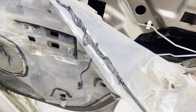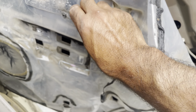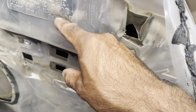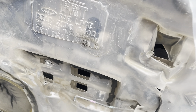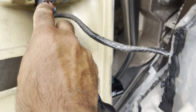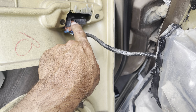Now we can pull the vapor barrier down a little more. This screw here is supposed to go under the handle — it's broken so it just pulled right out — but this is gonna have to be removed when you're removing the exterior too. That's the third one on the door panel. I'm also going to remove the window switch plug so we can get the door panel out of the way — just push this down with a flathead and it should pull right out.